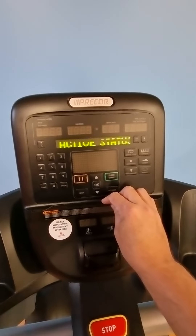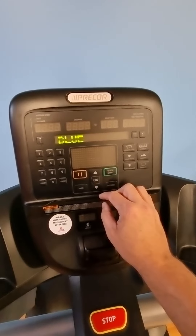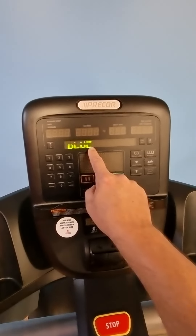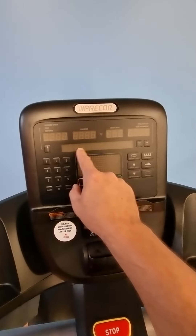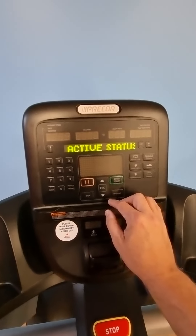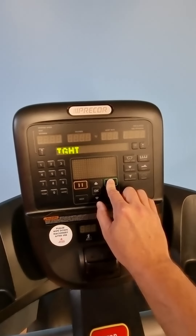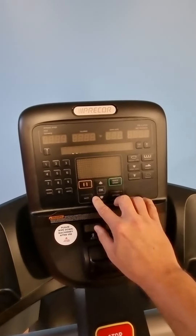The active status light setting shows the status of that light at the front of the treadmill. If it's flashing it'll say so here — blue flashing or yellow if there's a fault. We know it's blue now so that's fine and doesn't need resetting, but if it did, you press and hold the start button and it would reset that for you.